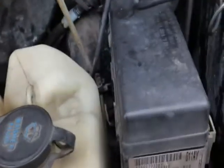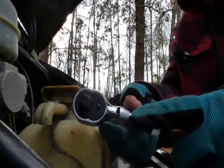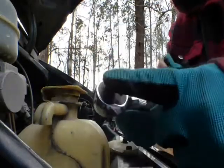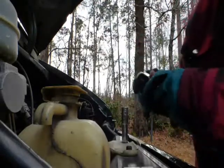That's going to be hard to get to so I'm going to have to take something loose. I don't know if I want to take loose the fuse box or this jug — the jug might be easier, just two bolts, move it over. Then I wouldn't have to disconnect my battery since this is not electrical. This is the new short-handle ratchet that I bought, which I think is going to come in handy. I could have used this doing my spark plug removal where I couldn't because the handle on the other one is too long and I didn't have the clearance. It has three-eighths and quarter-inch sockets on it.